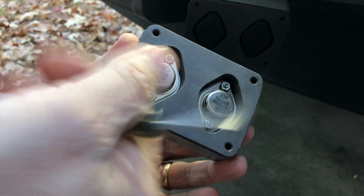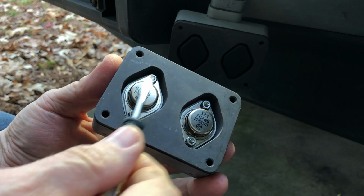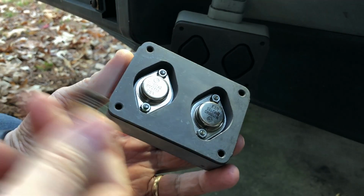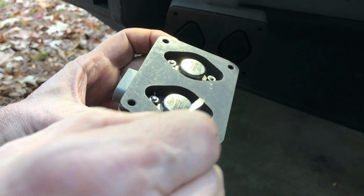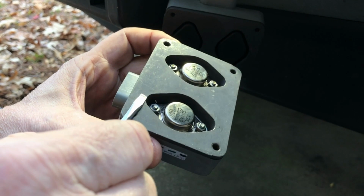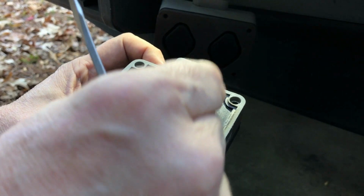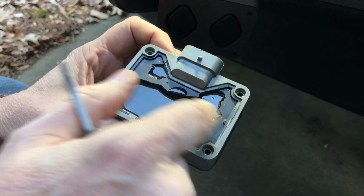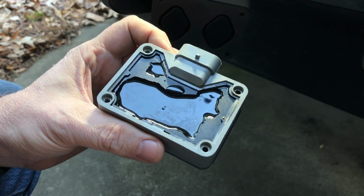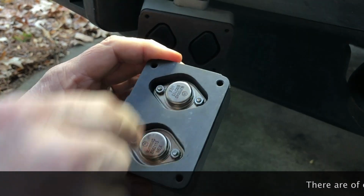They can come loose, and then with all the cycling, you can end up getting the solder connections on the board with the base and the emitter of these transistors, and you end up having a break in the connection. Getting these guys loose can also break the thermal connection that they have to this built-in heatsink, and they can fail that way. They can also fail because we get the potting material flexing with thermal contractions and expansion, and we get a break in the solder joints of that transistor that way as well.